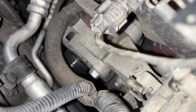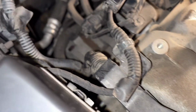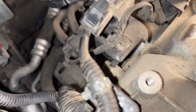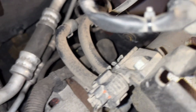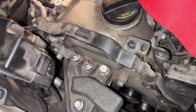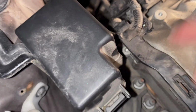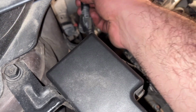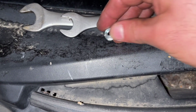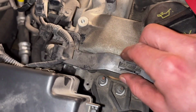As you see here, we have one bolt here and one here, and we have the 2 cables, the big ones that are going to the alternator. That one there that is protected, and the other one. So I moved a few things from here. I disconnected the alternator cable from here. It's this one, a 10mm nut that is holding it. So this is the nut, save them, do not drop them anywhere. And I moved this to have some freedom here.